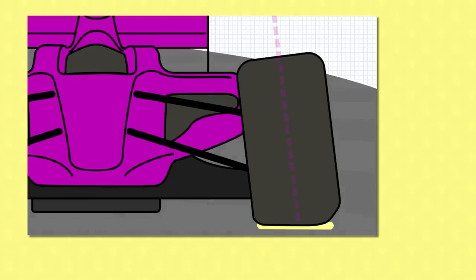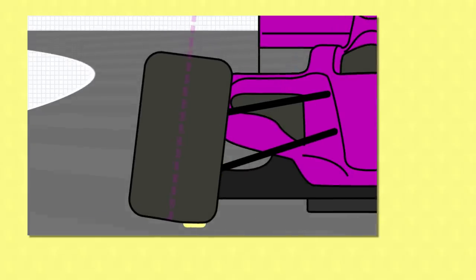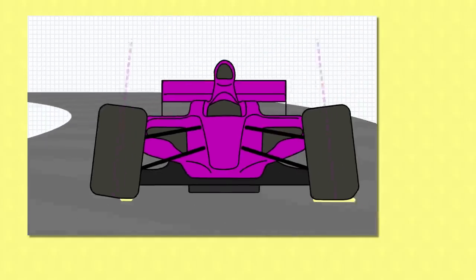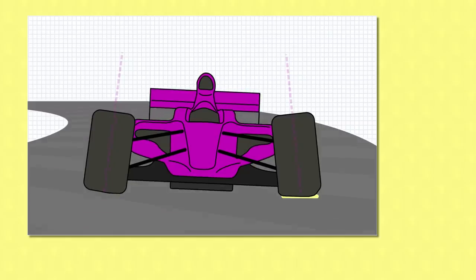Note that we are looking at the outside load-bearing tyre here. If we look at the inside tyre through cornering, we see it's cambered in a way that actually makes it rest more on one edge through a corner, creating an even smaller contact patch. But because the outside tyre is doing the majority of the load-bearing, the concerns of the inside tyre are minimal. In fact, depending on the suspension settings and the corner, the inside tyre may sometimes lift completely from the track or be very close to lifting, as the roll of the car and the alleviation in load literally takes the burden away from it. So we're happy to sacrifice the inside tyre here.